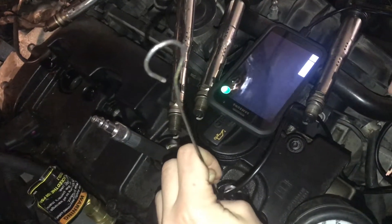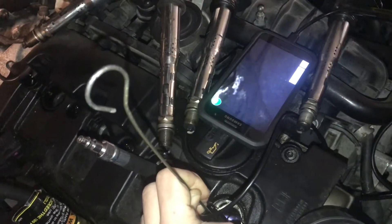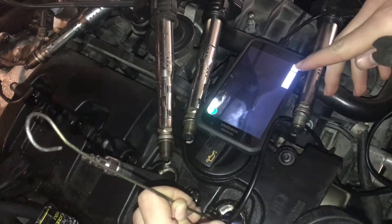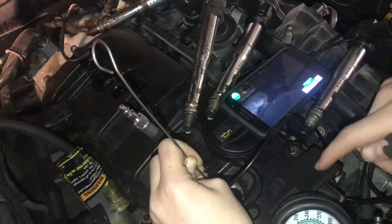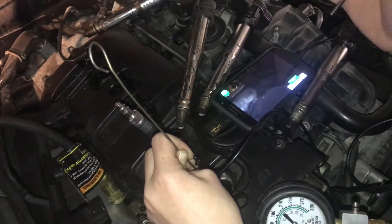This valve over here is what it should look like — a uniform arc, not all burnt and chipped like that. That's definitely not good. That's not what we want to see, and that is on the intake side of the cylinder. If this is causing our leak — which it probably is — that looks like a smoking gun.